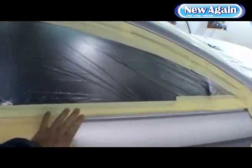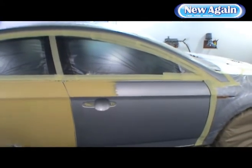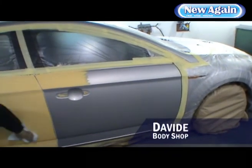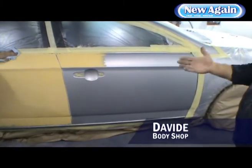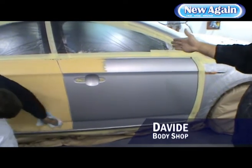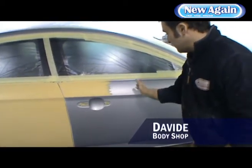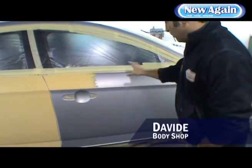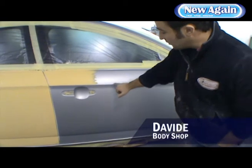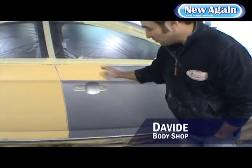Why wouldn't you just repair that area and stop just past here? With a lot of metallics and modern colours, you have to give yourself plenty of room to blend the colour, because temperature, application, and various other factors can make the colour look different. If you were to colour this area, you would have to put your silver at least to here and fade it in, then lacquer a bit further. It's not much difference to just lacquer all the way to the end. But if you stop at this line, you've got primer, colour, and lacquer all in one line — that's too much of a build-up, so you'd have a step there.